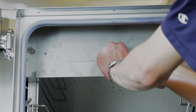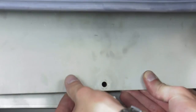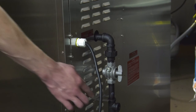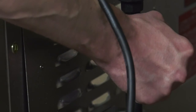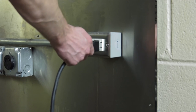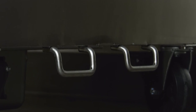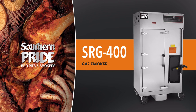To inspect the blower wheel for the convection fan, unscrew the thumb screw to remove the panel. The smoker can be powered by either LP or natural gas, which connects to the drip leg here. Make sure the gas valve is turned on. The smoker is powered by regular 120 volt electricity. The tie-downs on each side of the smoker can be used to secure the smoker when delivering on a flatbed trailer. Refer to the smoker's owner's manual for further operation and maintenance instruction.